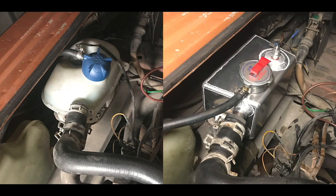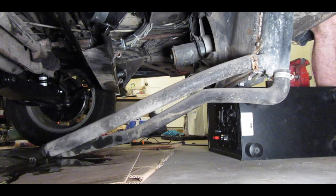A well-known issue with these vans is the expansion tank for the cooling system — it uses a cap that very often goes bad. You need pressure with a very specific pressure valve, and when it goes bad it can cause symptoms that seem like you have a head gasket problem, which I was sure I probably had. I was going to address everything that could point to a head gasket before getting to the head gaskets themselves. Since I was already doing the evaporation tanks, I also took care of the expansion tank, changed the radiator, and put in a water temperature gauge to track coolant temperature.